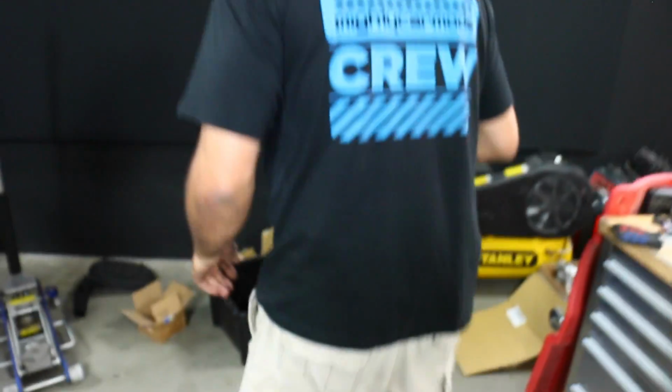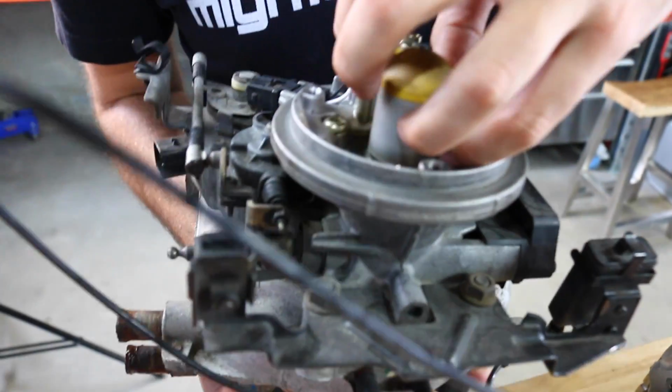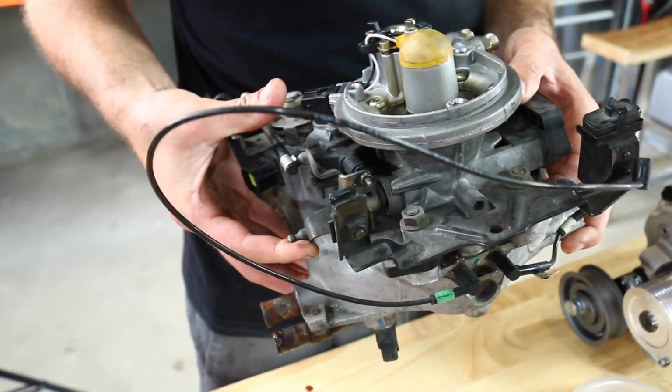That's awesome. So here we have the original inlet manifold. Now this might look a bit different to what you traditionally find on the older Minis, which would have carburetors. You can put twin carbs, do all those kind of old school things. But this is what I like to call, and a lot of people call, toilet bowl injection. Basically, that's one giant injector that sprays fuel onto the throttle body, and then you've got your cable linkage there, and it opens and shuts. Which is basically just one injector.